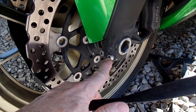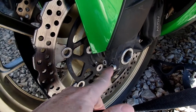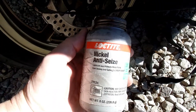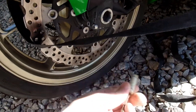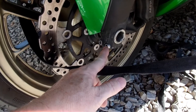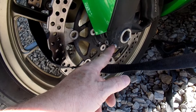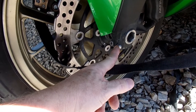There's also a problem in that this bolt is steel and this is aluminum, so you've got dissimilar metals. What I'm going to do is take one side out at a time, use my anti-seize, take a small screwdriver and coat that backside, and then tighten these back down. You're supposed to torque them — figure out what your torque spec is and go by it.